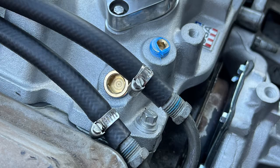Next, you need to connect your factory fuel lines to the fuel pressure regulator. What I did was a little bit sketchy — I took 3/8 fuel lines and some hose clamps and connected them to the factory hard lines. It is a little sketchy because that is a high-pressure fitting and you're using a hose clamp to keep it down. However, it does work. I don't recommend doing it, but if it's all you have at the moment, you've got to do what you've got to do. The long-term solution is to get steel-braided hose with the proper fittings. You will definitely need 3/8 MPT barbed fittings to connect to your fuel pressure regulator, so the hose does not come off and is very tight and secured.